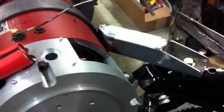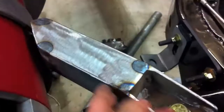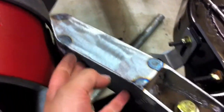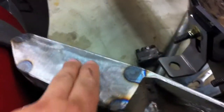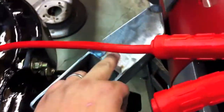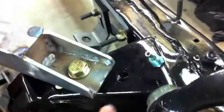So I did the same thing over here — you can see that bend. And then once I got that all welded up with the sides in the front, it was structurally sound. I welded in these little back plates — this one there and one right here. And then I set in these top plates here on the two, ground them smooth, and then I just beveled these down for a little better look, rounded the corners off on them to make them look nice.